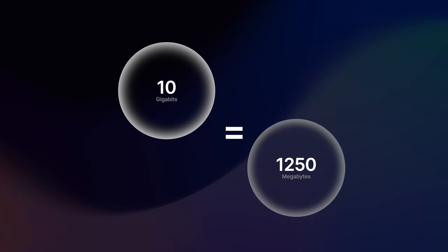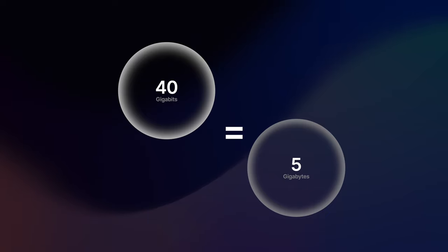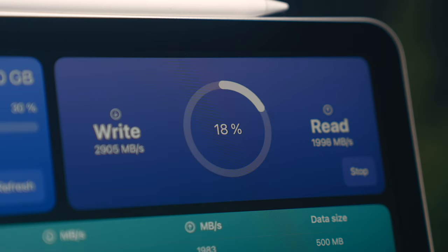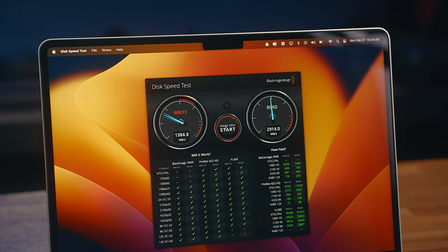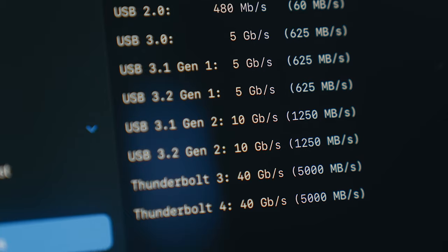The M1 iPad Air port, on the other hand, runs at 10 gigabits or 1,250 megabytes per second, and can transfer large files relatively quickly and is overall pretty snappy. Finally, the M2 iPad Pro can run at USB 4 or Thunderbolt speeds, capable of 40 gigabits or 5 gigabytes per second, and rivals the internal SSD drive speeds of some pretty powerful machines. That's something that might be useful if you have a workflow with super demanding file transfer requirements like video editing, or you just want those insanely fast transfer speeds. Knowing that port specification will give you a pretty solid foundation for understanding how fast a flash drive or SSD can potentially run on your iPad.